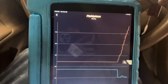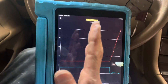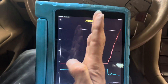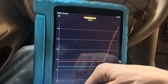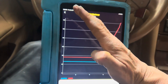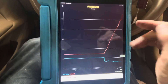Because the faster the compressor spins, the more pressure you can make. But remember, this is a variable displacement compressor — it doesn't care about the RPMs. What it'll do is take that swash plate: when it was at 1200–2000 RPMs, the displacement was just a little bit, just moving the pistons back and forth a little. But when the RPM goes down and the compressor becomes less efficient, it hits that actuator solenoid valve and kicks the swash plate all the way open — high displacement — so it can still displace refrigerant at the same efficiency.